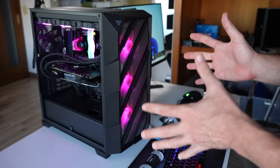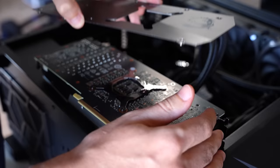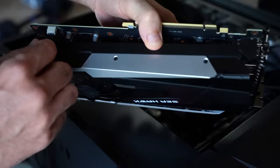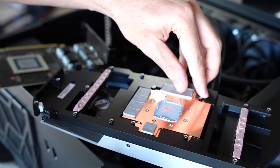I've just finished the memory pad upgrade on the 3080 Seahawk. It was actually relatively easy on this card in particular because they used all the same screw heads, so I only needed one screwdriver to take it apart. I also changed the thermal paste while I was at it. You may be wondering how many pads were needed — I used about one and a half pads, just a little under.